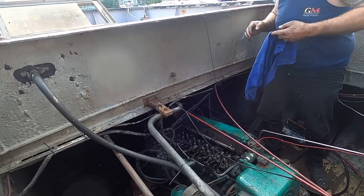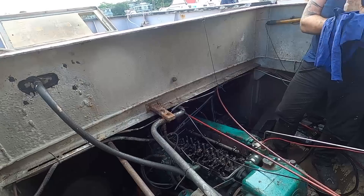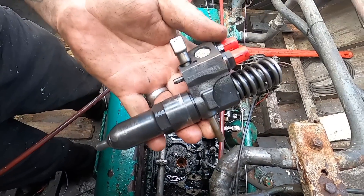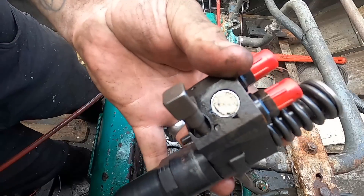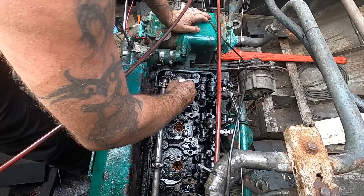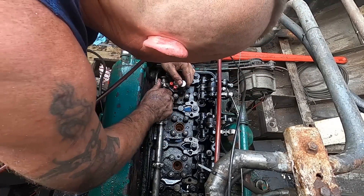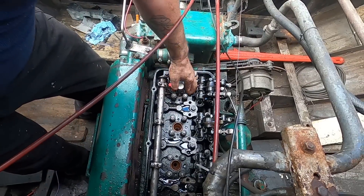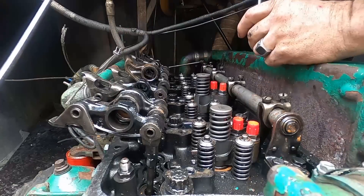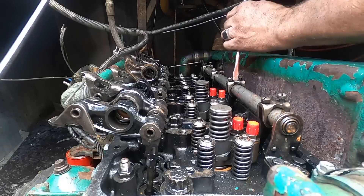It's turned over a fair bit, so what do you reckon? Pop the new injectors in. Put the new injectors in, turn the fuel on, see what happens. See it run — and then run away, get in the boat, go. These are only little suckers, just little fifties. Same as what we're going to put back in Stu's boat. Just make sure the rack still moves once you get it in. These are a little bit tight — the rack wants to bind up there and there. But like that, bingo, in he goes.